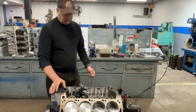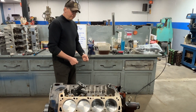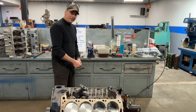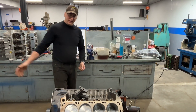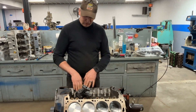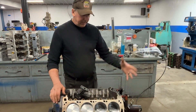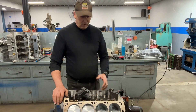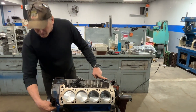Well, again, you're washing your car and filling your bucket. Now maybe you string two hoses from the house, but both of them have leaks, and you're filling your bucket, but you still haven't fixed the leak. You haven't fixed your volume of oil getting to the main bearings because you still have the leaks. What this usually does — and you'll say, 'oh, but my gauge reads much higher now, so the engine must be seeing something better' — well, the gauge is reading higher because now you're going back to the same Windsor style where you're reading the pressure right off the pump.